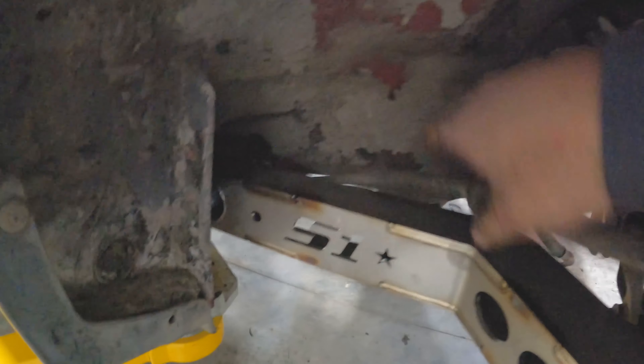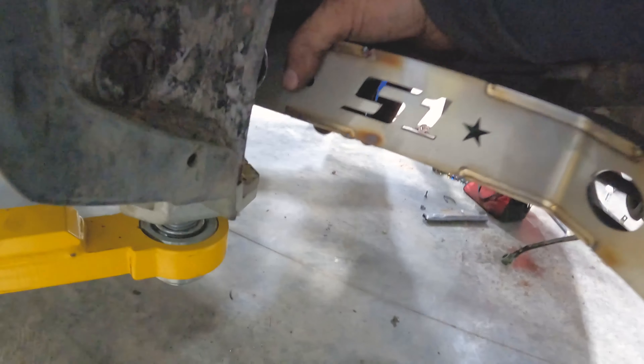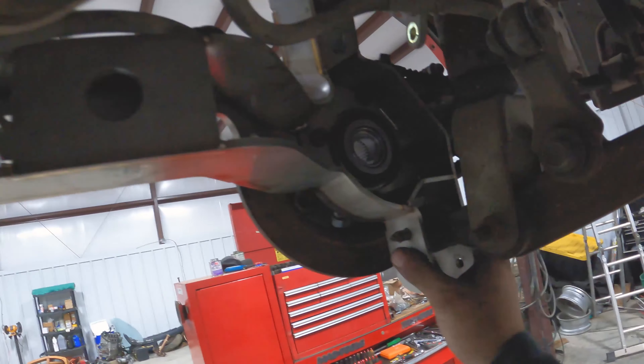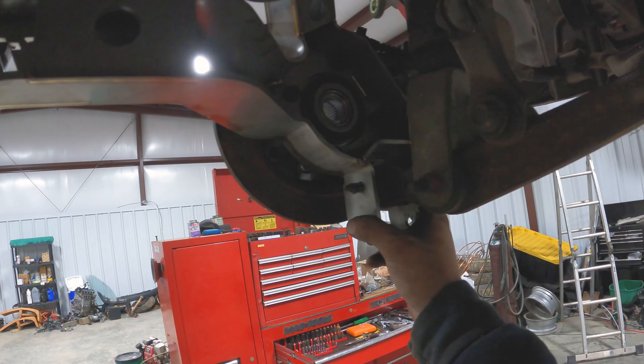It's kind of dark but I did get one bolt in there, up at an angle and still hitting, but I was able to drive it in deep enough to where it's definitely not going to go anywhere — got the pin back in. It's not exactly how Honda designed it to work, but it's gonna work. The only thing I was noticing is it's gonna be kind of clanky — the other side is a little bit louder. I'm gonna have to come up with some kind of bracket and actually bolt this to it. There is a little bit of metal-to-metal contact there, so I'll keep an eye on that for future reference. Also, there are a couple of nuts missing — I gotta address that, but I don't have the nuts.